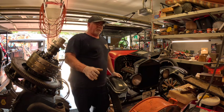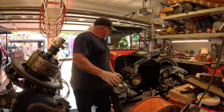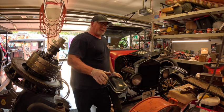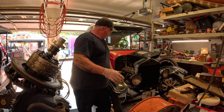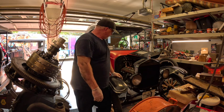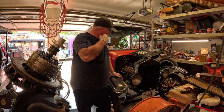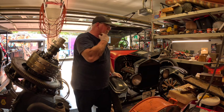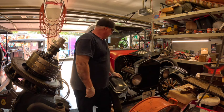Good. We never had a problem at all with the way this engine ran. We had to clean the timer out. I think I've mentioned that before. We do have an e-timer in this. And number one plug fouled out some, no big deal. Thing I mentioned before, we changed the intake in Arizona as well. Changed from the aluminum to the cast iron. We ended up having one warp on us, no big deal there.